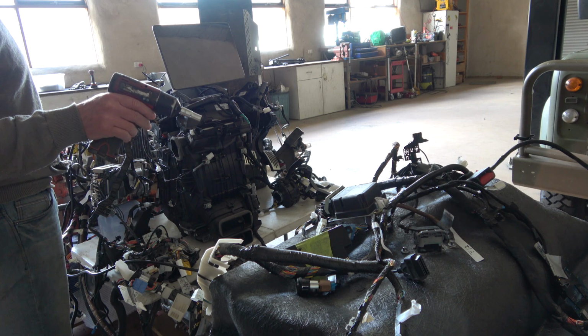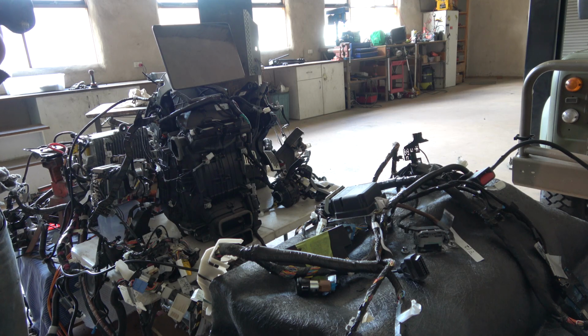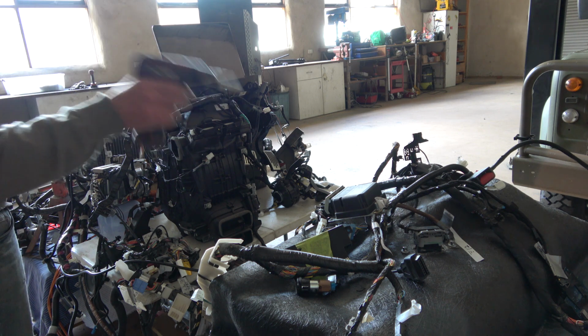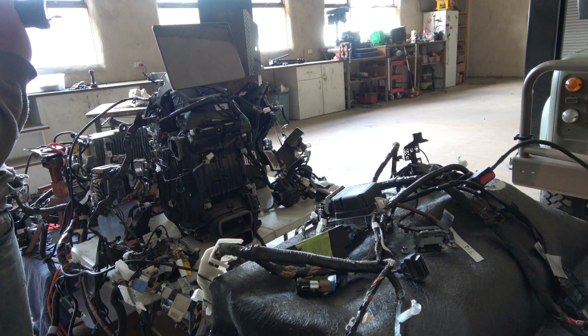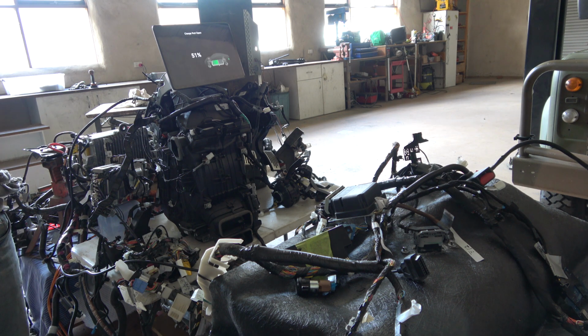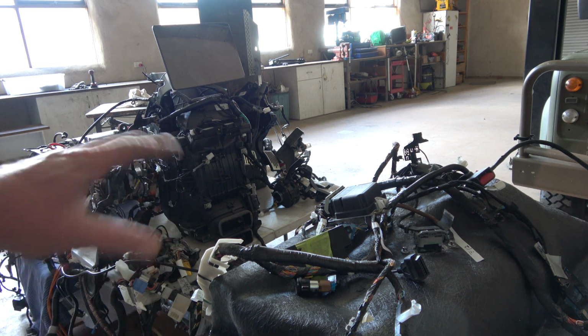Have I left out a high voltage interlock? You will have seen in my previous videos reconfiguring the Tesla Model 3 battery and high voltage system. I wonder if I've got the correct earth on the penthouse. So I've done quite a lot since I last had this up and running, so it's not overly surprising that something's not quite happy. Charge port open, interesting. I don't have the charge port door connected. So it obviously didn't connect the main contactors, because you'd hear the big clonk.